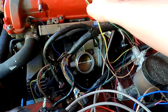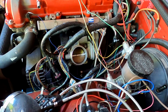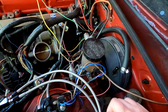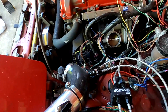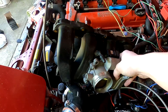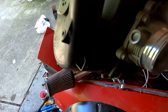The first thing I'm going to do is remove the intake manifold — you can see I already have it loosened up. On the Ecotec Miata swap, the only thing that should be going to it is this brake booster line which I have disconnected here, the actual intake tube and air filter, mass airflow sensor, the actual throttle body and a map sensor here. Those are all disconnected, so now this should just come out. All right, so we got the intake manifold out.